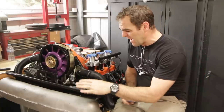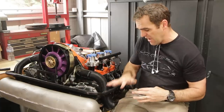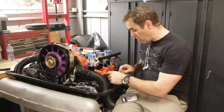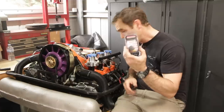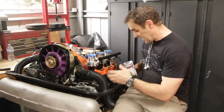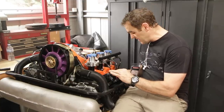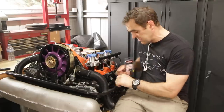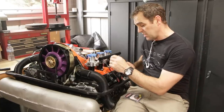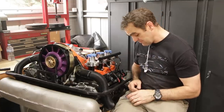I just went and painted the straps, and I've also painted my engine brace, so I'll leave that while it's drying and head back over to my loom and continue putting on the plugs for all of the coil packs. RaceWorks supplied all the plugs and everything for the coil packs as well, and having all the right plugs works out really well. I'm going to tape up all of these ends now, tape them so I can hold all of this expanding mesh nice and tight, and then I can start sliding on my little sections of clear heat shrink and the covers so that it's all going to be nice and neat and tidy.